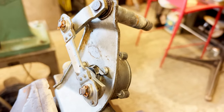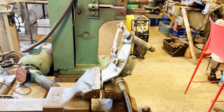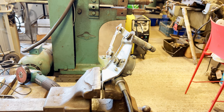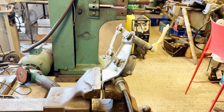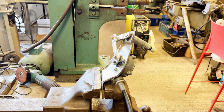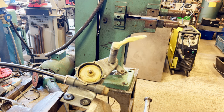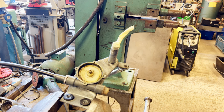Let's have a look at this in operation and see what it does. Our worm drive is running that gear, which is turning that lower crank, which is turning the upper crank, which is starting that spindle and wiping the window. If I put some tape on it you'll see — it's just to look like an arm going to and fro. The cog just keeps going round and round driven by the worm drive; it's the cranks that make it do the actual wiping action, going through an arc and reversing.